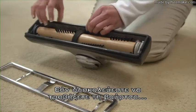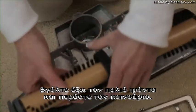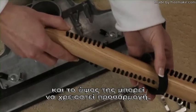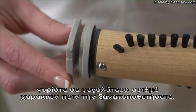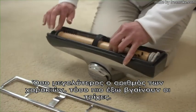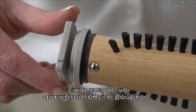If you have difficulty removing the brush roll, tap the front bumper on a flat surface to dislodge it. Slide the old belt off and slide a new belt on. Over time, the bristles on the brush roll will wear and the height of the brush roll may need to be adjusted. To adjust the height, turn the brush roll to a higher number of notches before reinserting it. The greater the number of notches, the further the bristles are extended. If the brush roll needs to be extended beyond three notches, it is time to replace the brush roll.